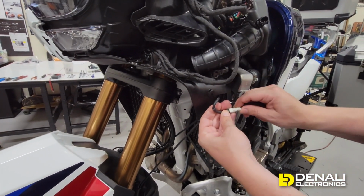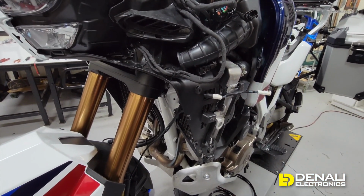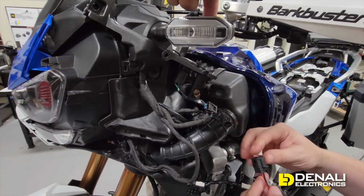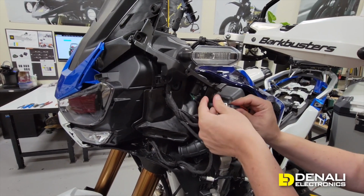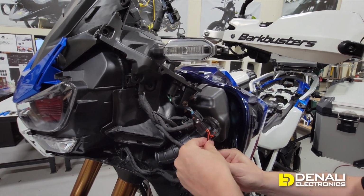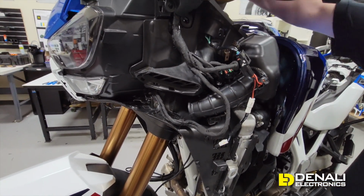So he's plugging the two leads together to our splitter, just a Y splitter. And then what we've developed up here is, off of the 12-volt cigarette socket, a simple plug and play adapter. So he's plugging that in line to the cigarette socket, and that leaves a DRL plug for us to plug directly into our DRLs.